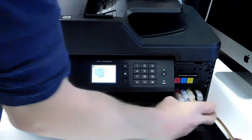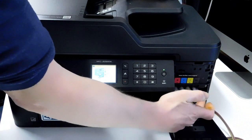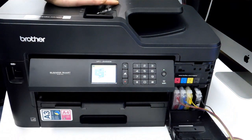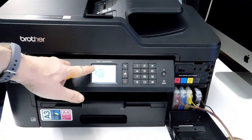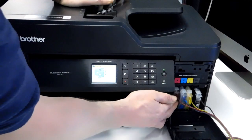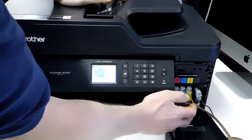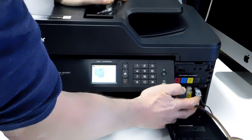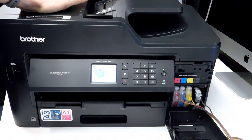The cartridges come in at the side, so we're going to pop the cartridges into the printer just like so. You can see it gives us so much more room here to come in at the side entrance to the cartridge, which makes it easier. You have to install these very slowly. On the display it says 'installing' — normally when it's put in that changes. Push them in very slowly, and if it says 'not detected' take them out, put them back in and repeat the process.